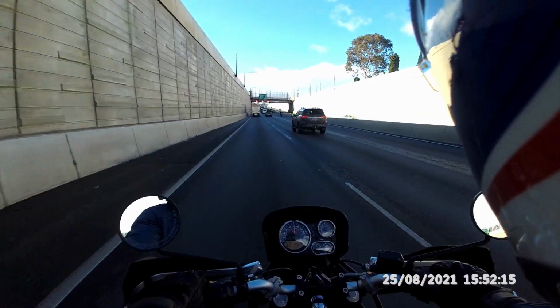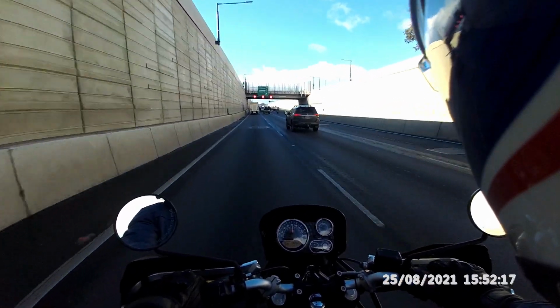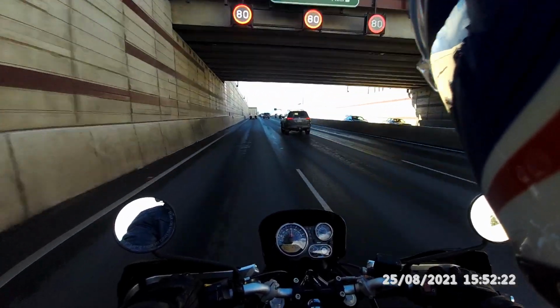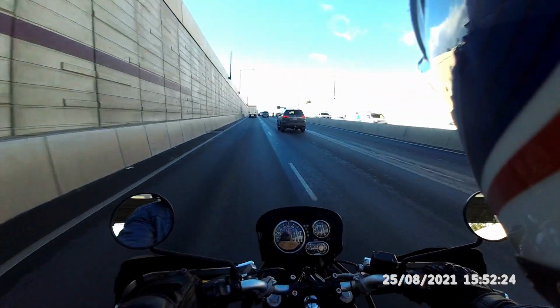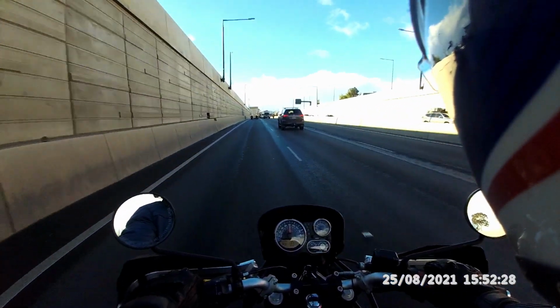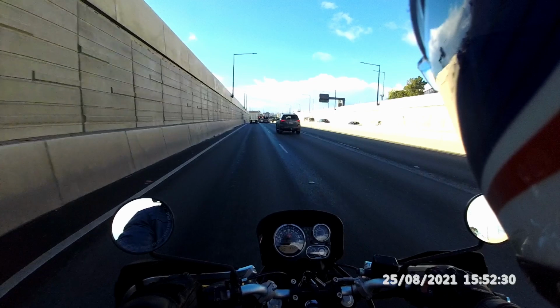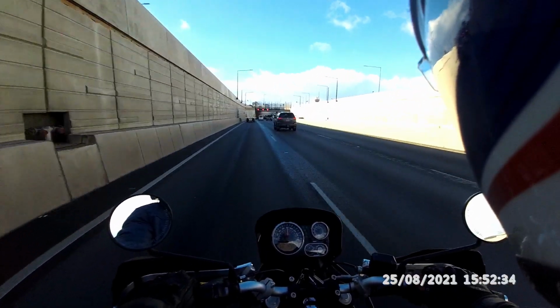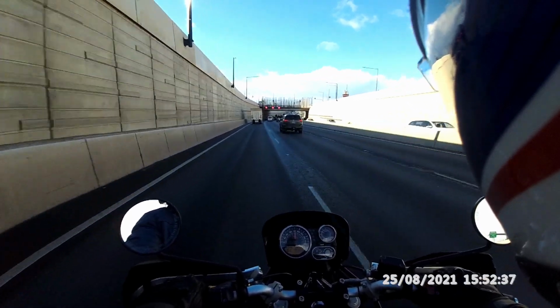And of course, once I whack the sidecar on, it'll be getting more force through the back, and I've got room to dial it up. If I was doing this for a solo, I probably wouldn't put 9mm in the back. I'd probably only put 6. But that doesn't matter.